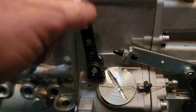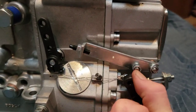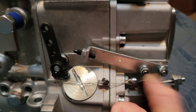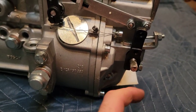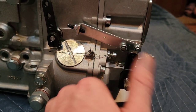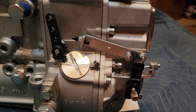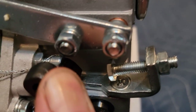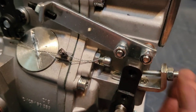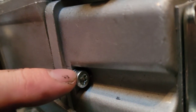It does have the shutoff solenoid lever and the throttle lever, both come with it. The throttle is a little bit stiff — it has really good spring back with no external springs. Every Bosch pump I've ever throttled feels really loose and moves freely, and you have to have external springs to get it back to idle. The idle stop set screw looks very different, but it looks like it would be really easy to adjust compared to the Bosch one. Looking at all the types of screws and fasteners, these are a five-point head — so it's not a Torx.